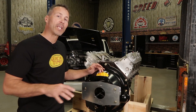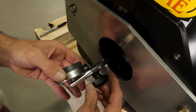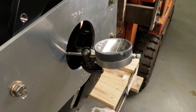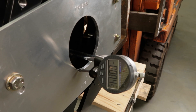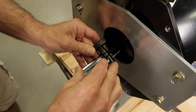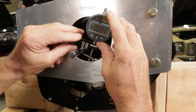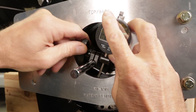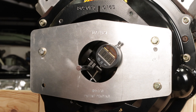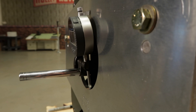We now have a precision hole that we can use to index and center our bell housing with the crankshaft. Another good practice is checking the bell housing parallel — we can do this quickly with the dial indicator to tell us how close to parallel the back of our engine block is to the back of our bell housing. Look for something within five thousandths of an inch. If yours is not within spec, double check for any debris or imperfections between any of the mating surfaces. Now we're ready to index the bell housing. Adjust the plunger of your dial indicator so that it makes contact with the inside bore of the hole found on the QuickTime indexing plate. The ball of your indicator should be centered on the thickness of the plate, and try to get the indicator as parallel as possible to the plate. Make a few 360-degree sweeps to make sure you have full travel and that the indicator isn't bottoming out or losing contact with the plate surface. Also make sure that the dial indicator and mount don't make contact with any part of the bell housing or indexing plate while rotating.